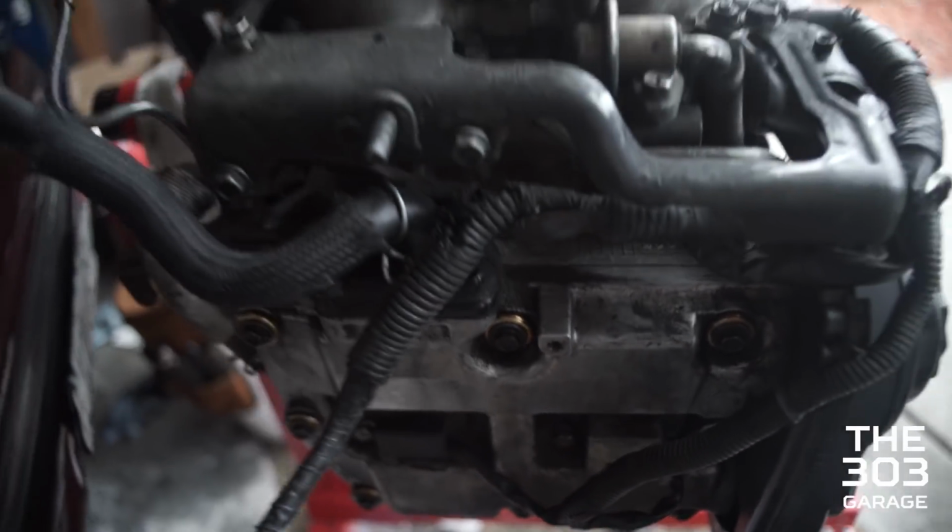Most of the lines are attached. It's not a lot, and we got our coil packs in down here. So now we're gonna put our timing covers on because we believe that it's timed, at least where it won't destroy the engine. If it's off time, we can fix it.